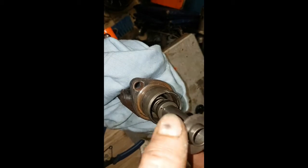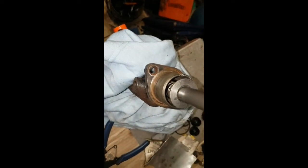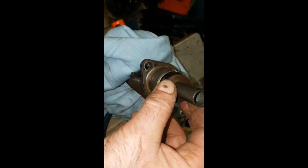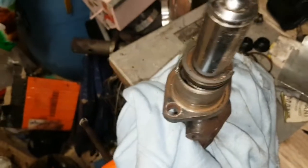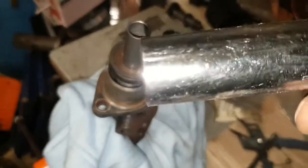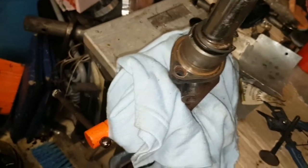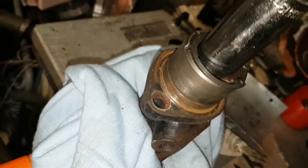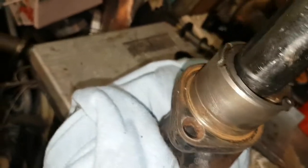It goes back in there. So what you're going to need to do — once it's all in, you're going to need to push all of that down. Get the seal in place first. You're going to need to push that in so it sucks the seal in. I've been experimenting — I've got a long 19mm socket. I need something to sort of compress that in while I'm putting the circlip in. So that goes in there like that — I can hold that and use the circlip pliers while it's held sturdy. And then get it in that recess, and that'll be done.